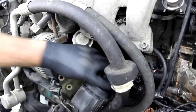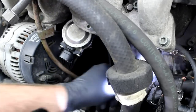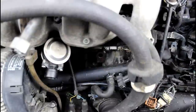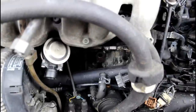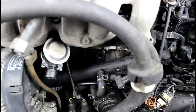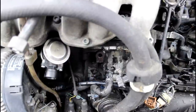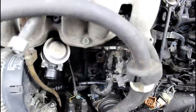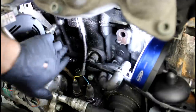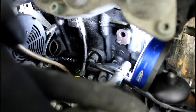I'm going to go ahead and rock this pump out of the way and unplug it. Now we can see our coolant pipe plain as day. Here's our pipe — I've got very easy access to the clamp, which comes right off when you gain all this room. The pipe comes right out. There wasn't any sealant on the end of that pipe, but it was basically oxidized inside the block where it goes into the back of the water pump. Just like with the flange, I'm going to get some Scotch-Brite and get that cleaned up.